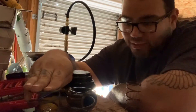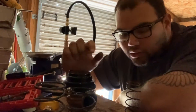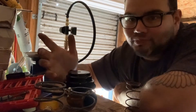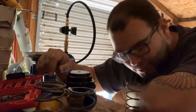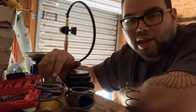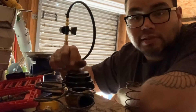We'll probably stick with the red spring since it seems to be the sweet spot, opening up where we want it. We can always turn it up with the boost controller, but being on 93 octane I don't want to run more than 8 psi right now. The E85 around me is not the best quality - everything's been testing at about E70 or lower. Once we find some that's at least E75 or E80 we'll start using that. For fun, we'll also throw the black spring in with the red spring and see what it does together.